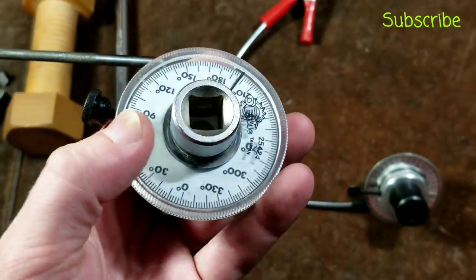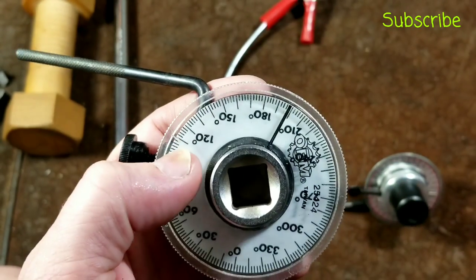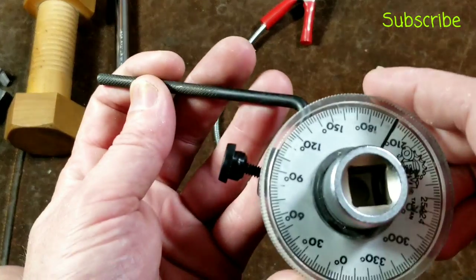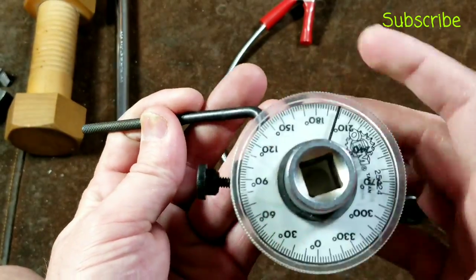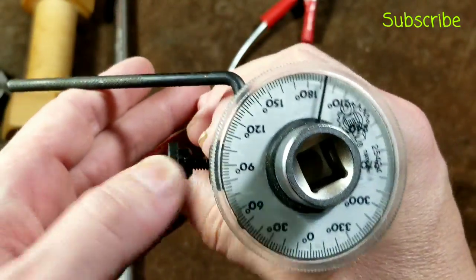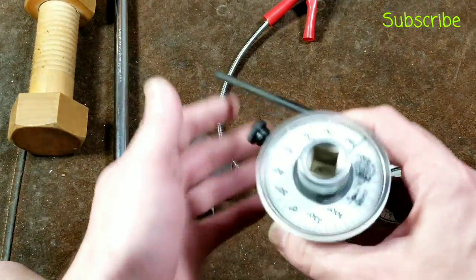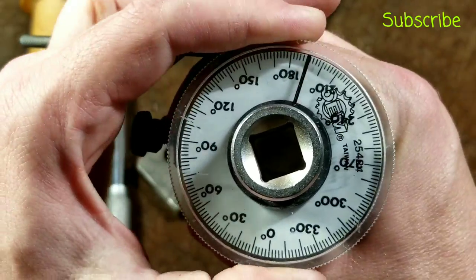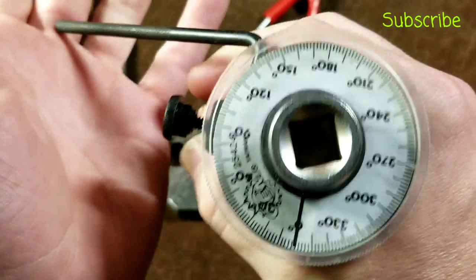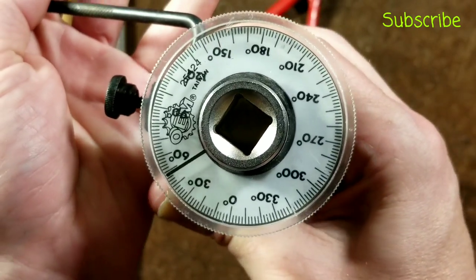These are just a two-inch extension, and the extension is actually attached to the dial portion — the part that indicates the degrees. The little arrow would be attached to the portion that the arm is connected to. So as you turn it, with a socket on and the tool against something fixed on the fastener, hitting against some part in the engine, once you've got it all set up, you rotate the dial all the way around to zero so it's easier to read.